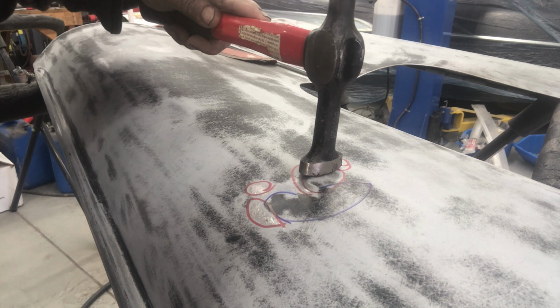There you go. All right, as I said earlier, all the lights for the headlights and all this have to go on here because there's no way of crossing back over anywhere. You can't do it. We've looked into it and you can't go underneath this fender anywhere. They're just going to be dangling down in the middle of the rail. Can't go against the underneath of the engine because then you're going to have to cross over here. So this is the smartest way, up through here.